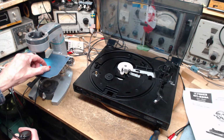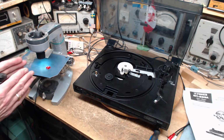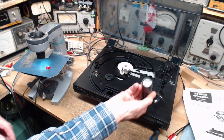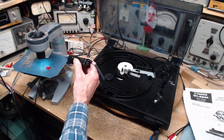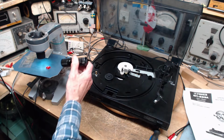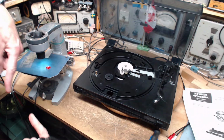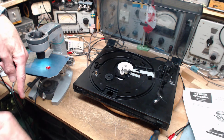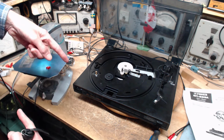So you can see the angle I have it on. You can imagine the flat spots would be on these sides. So I'm attempting to take a light, I'm just pretending here anyway, and shining it at the flat side. The idea is you go like this, and what you should see is a line rotating around the cone. But if it's flattened off, when you get to a certain point, you'll see a big flat area.